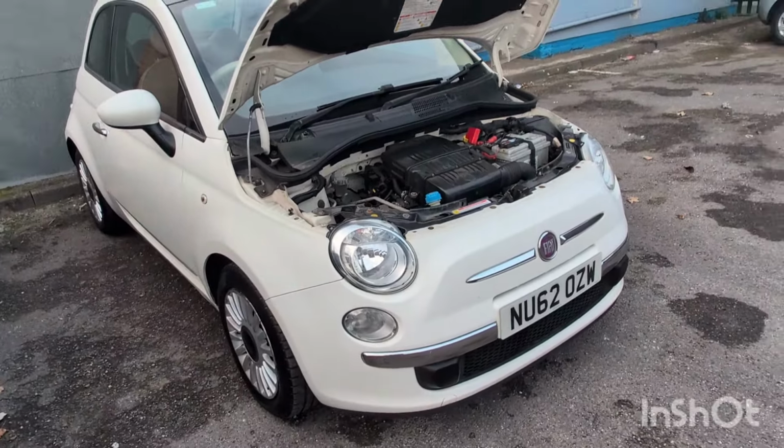And wait for it. Oh, tyre warning light. So, well, that's better than it could have been, surely. I was expecting oil pressure. There is a slight knock on the steering, but if you look at the last MOT, it has advisories for, not ball joints, two track rod ends. So I'd like to think that's what it is. The steering's slightly off, so we'll be getting some new track rod ends fitted.